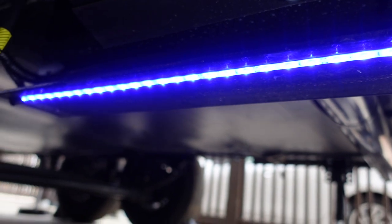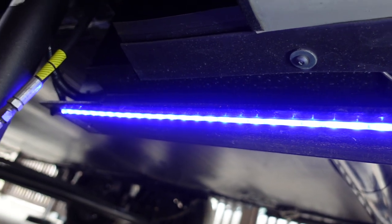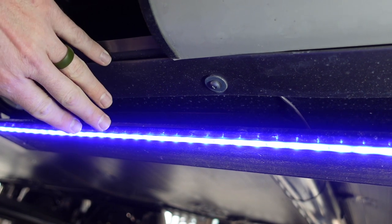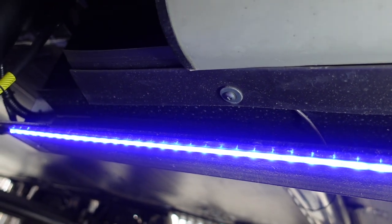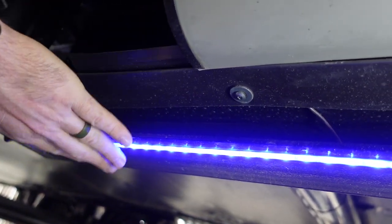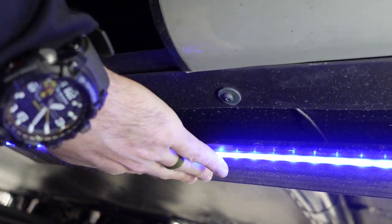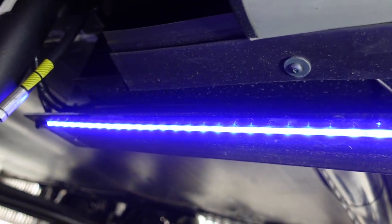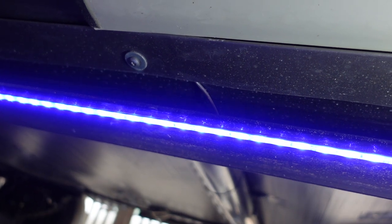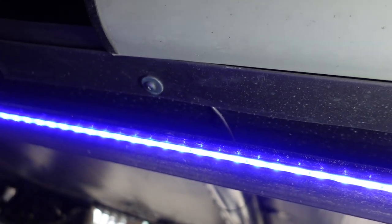The strips come with an adhesive backer — a peel-and-stick backer. First I dry fitted everything, tested it, then soldered everything and made it permanent. Before mounting, you want to wipe everything down — this is exposed to the road and gets really grimy from things splattering up on the bottom of the I-beam. I used alcohol to wipe it down and make sure it was nice and clean so the adhesive has something to bond to. The last thing you want is your strip flying in the wind down the highway. I carefully peeled off about 12 to 16 inches at a time and pushed it firmly — it's a pressure-sensitive adhesive.